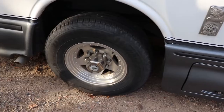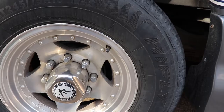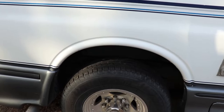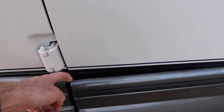Check your tires for cracks. You can look for date codes on the tires, but on these ones the date codes are on the inside — possibly intentional to keep people from returning them. Check for odd wear and check the wear bars. On a vehicle like this you're unlikely to wear the tires out; they'll probably rot out before you wear them down. Look for any damage; I'm missing a piece of rubber trim that popped loose over winter and needs to be reattached.